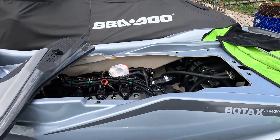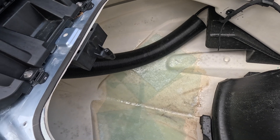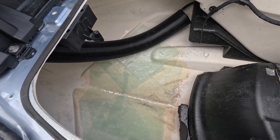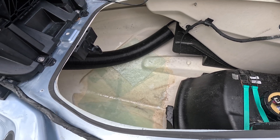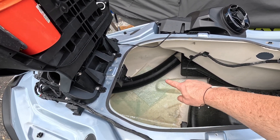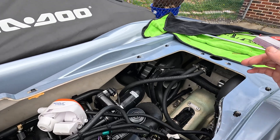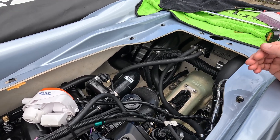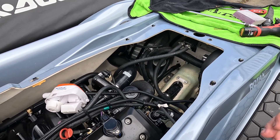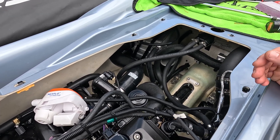And that is it. I ended up doing two layers of fiberglass on the jet pump tunnel and just about two layers on the front — you can kind of see the overlapping layers there. This is going to take about three hours to become tack free, and then it'll be another few days before you can actually start using it with the medium hardener. On the ST3s it's beneficial to do regardless of your power level, especially in that area. For the jet pump tunnel, there are people that blow them on a completely stock ski with no modifications done. I personally have never had a problem but I'm just reinforcing it anyway just to be safe. Very easy to do — I'll link the parts I used in the Amazon description so you can do it yourself if you're interested.